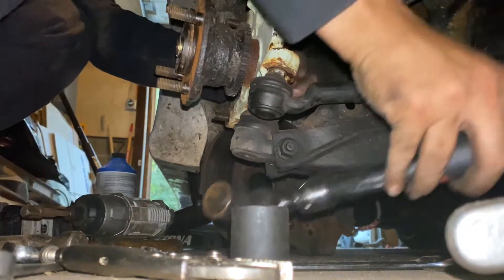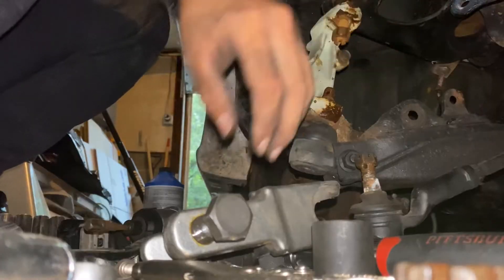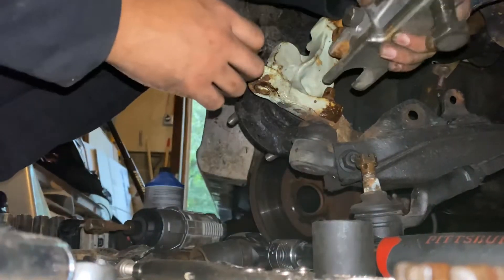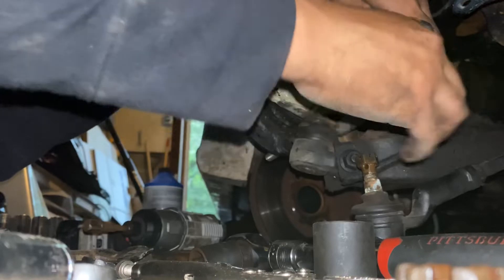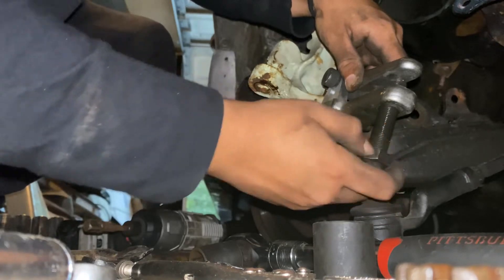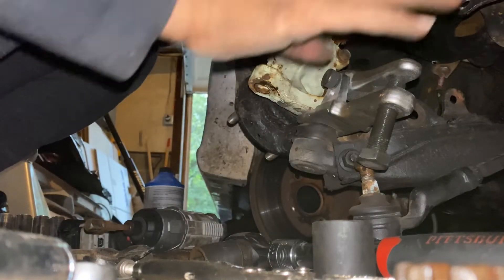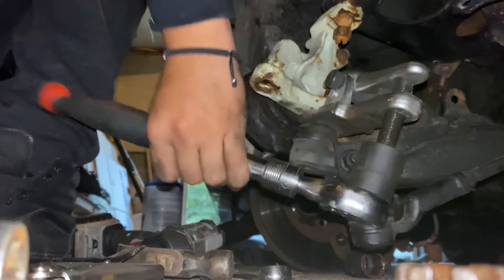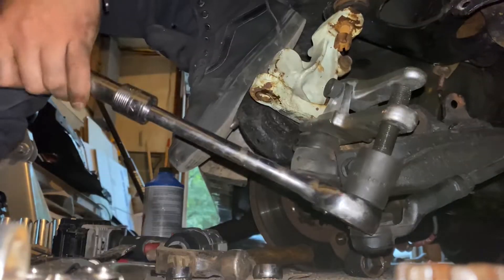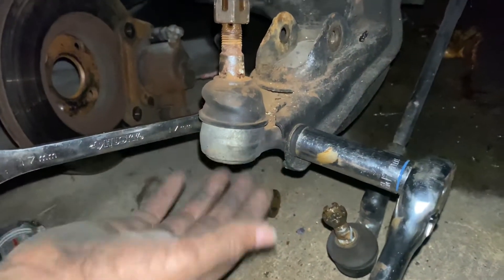Well, guess what? There's one. Get ready for a big boom — this is the one you guys have been waiting for. There was one time when I was doing this and when I was tightening it, it didn't go boom — it shot this thing. Scared the crap out of me, it went by so fast. I'm tying in the lower ball joint. I'm taking these ball joints out because these are extended ball joints and they add a little camber.